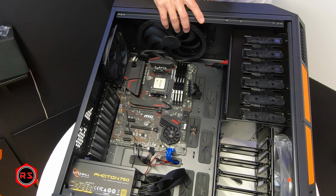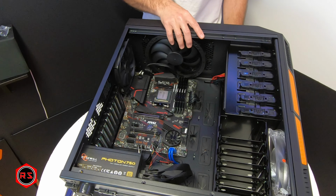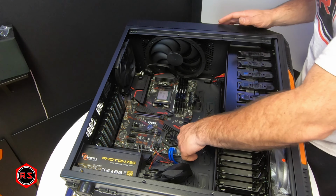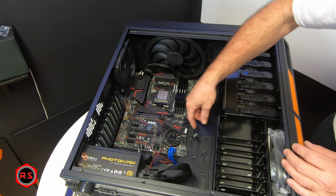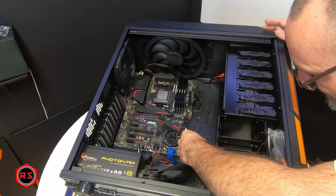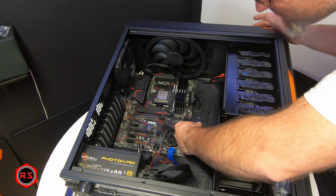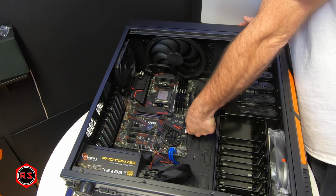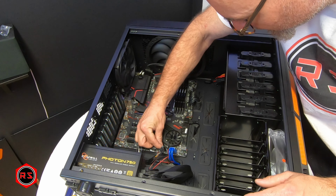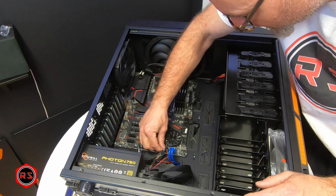The only cable that would get through the back panel on the side of the motherboard is the SATA cable, actually the only SATA cable, from the eSATA port on the front panel of this PC case. It is now time to connect every other cable from the front panel.